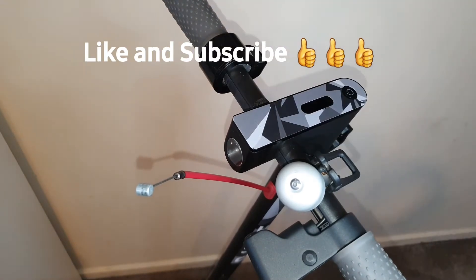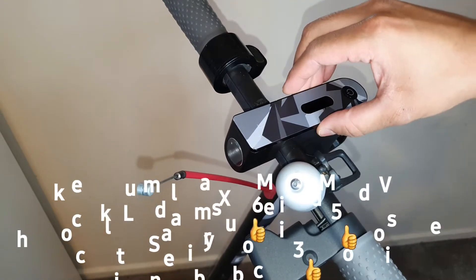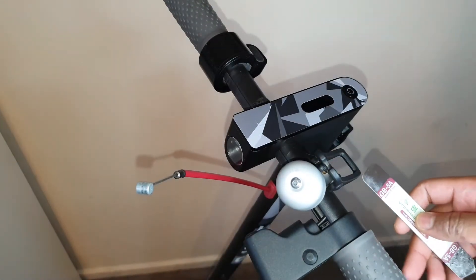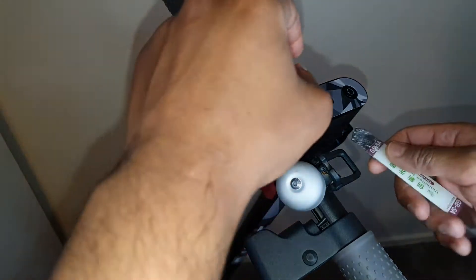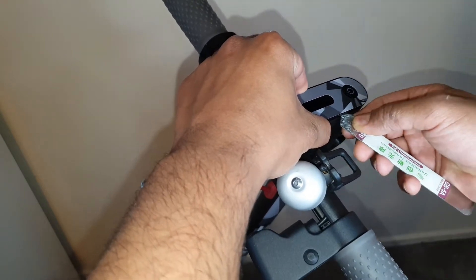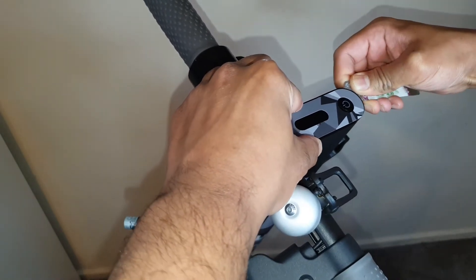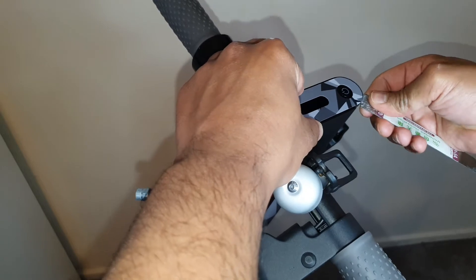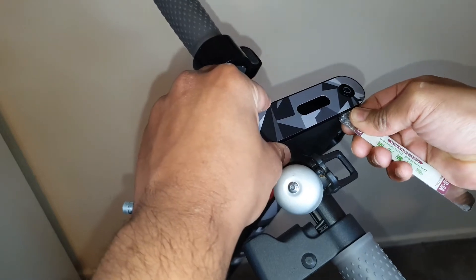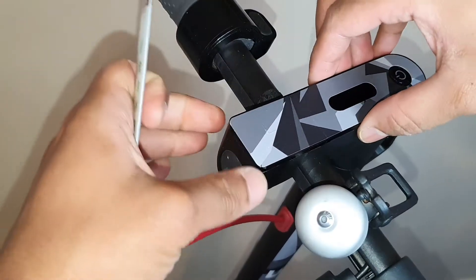Once you're happy that it's slightly warm, just be wary that this comes in two parts. We just need to remove each part because the scooter I purchased came with a vinyl wrap, which is going to make it slightly difficult to remove without damaging the wrap itself. So what you want to do is pry it up. I can already hear the adhesive coming off - as you can see one side is just lifted. I'm just going to lift the other side; don't damage the display, just in case you'll never go back or if you want to sell it later. Just slightly twist it and then you can just pull it off.